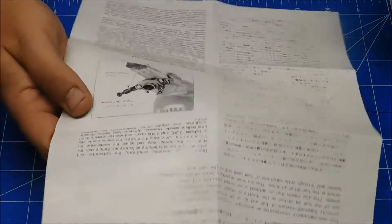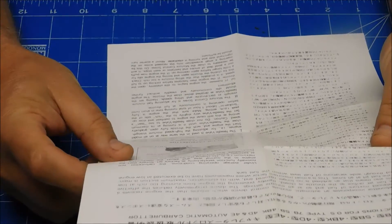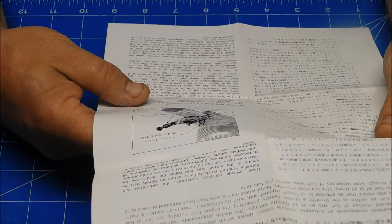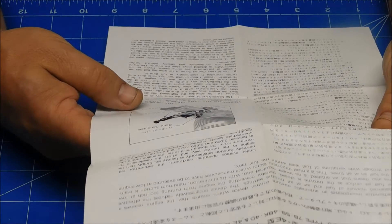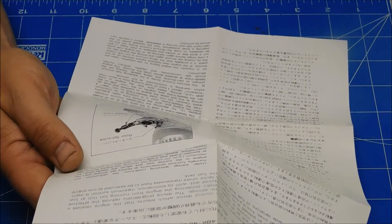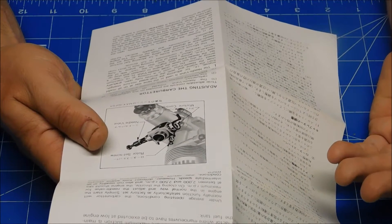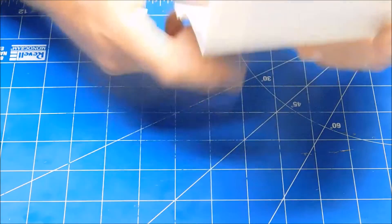The carburetor instruction sheet is very different. It basically says set idle between two thousand and twenty-five hundred RPM, but make sure the engine is fully broken in — about one hour of total running time in short runs — before operating it continuously at full throttle. So on one hand the engine sheet says you can basically run it really rich and throw it on a plane and fly it, whereas the carb sheet says gradually lean it out and have about a full hour of running in it before it's considered broken in.